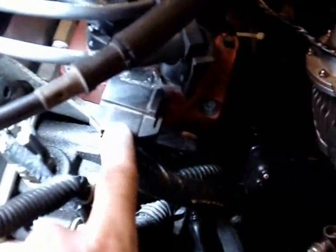This is it right here — a three-wire connector. It goes right to your coil pack where your spark plug wires come out. This is all you need to unhook. You've got two little clips on the side that hold it on. Just use a screwdriver to loosen them up and pull it off like that. Your ignition system is now disabled. Your car will not run with that unplugged.